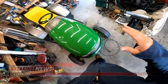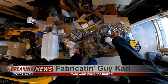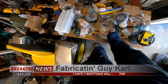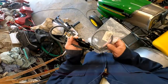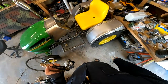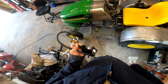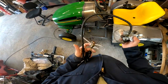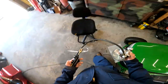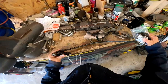Today I want to make the brake system for this. I have this old brake stuff, a new brake caliper, and a brake thing. I also have this switch that needs to go on here for brake lights. A few concerns: I have no extra brake fluid, I'll probably have to bleed this before I install it because I'm probably going to be putting this horizontal, and I don't think this hose is going to be long enough to reach where it needs to go. Those are all things we're going to have to figure out today.